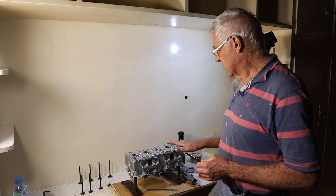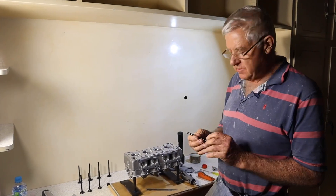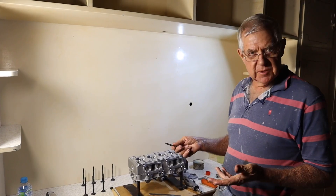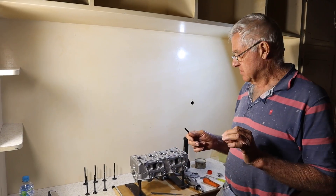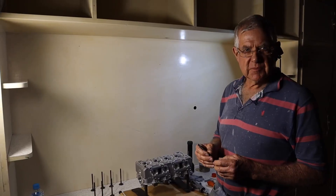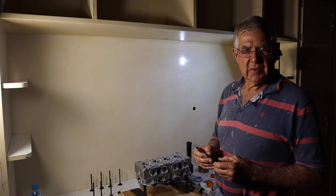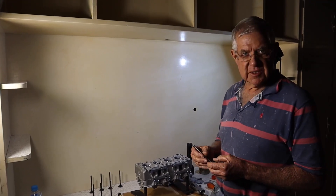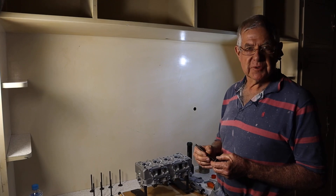So we'll just keep going and lap the other valves in. Once they're in, then we're pretty right. We'll put the valve stem seals on — on this motor I think they'll just tap on with a little socket. Then valve springs on, retainers on, collets in, camshaft in, and the head is getting pretty ready to be put back on top of the engine.